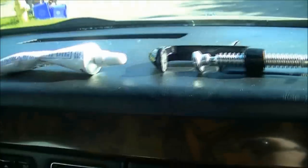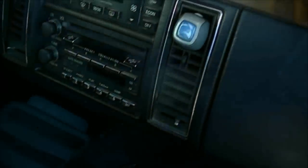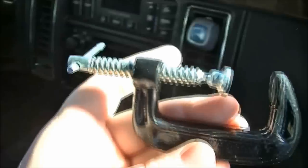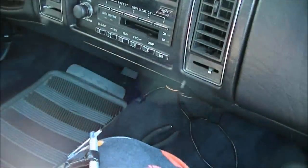The tools that you will need: first, it's recommended to use Ultra Slick White Lithium Grease or any other grease. I wouldn't use oil because oil will dry up and get sticky. You also need a two-inch C-clamp — you tighten it because this is what will snap the ball back into the hole. You can't use anything else; you have to use a C-clamp.